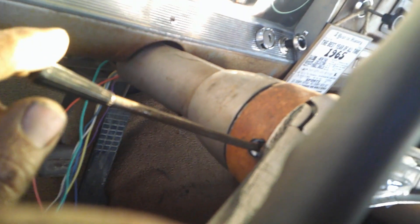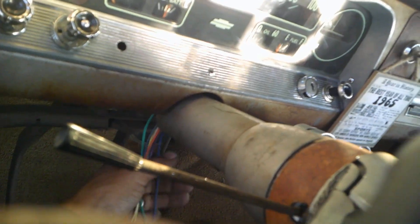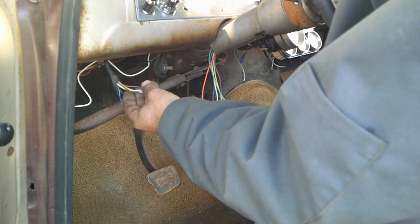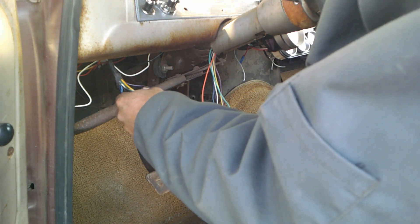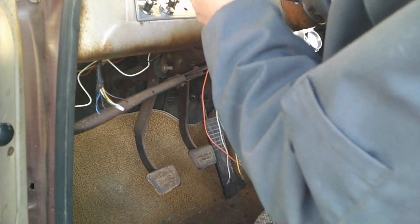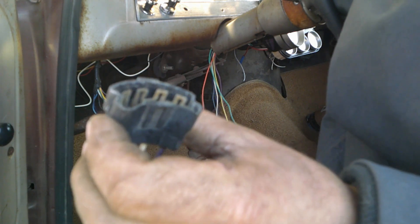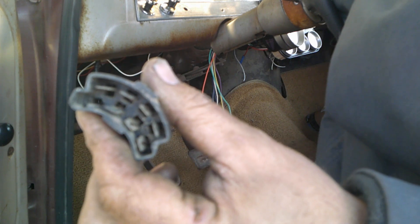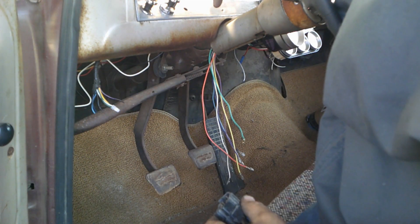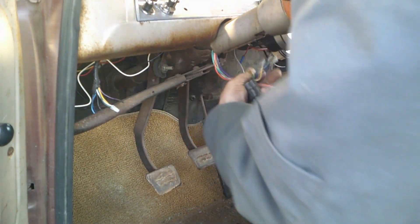Got that all hooked up. Now we're going to get all the wiring done. For the wire harness on this side, my switch was messed up, so in order to get my brake lights to work I had spliced the wires over here. We're going to go ahead and re-pin this plug — I have new blade terminals for it. We'll pop these old terminals out, crimp the new blades onto the other wires, and that way we'll have a nice fresh connection on both sides.